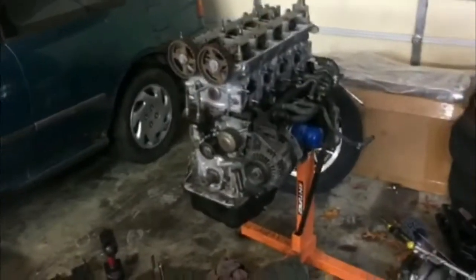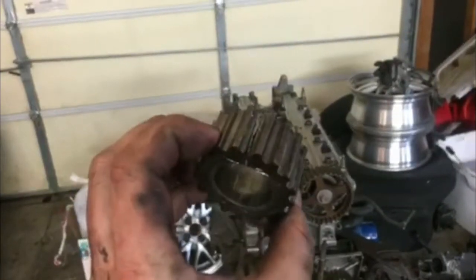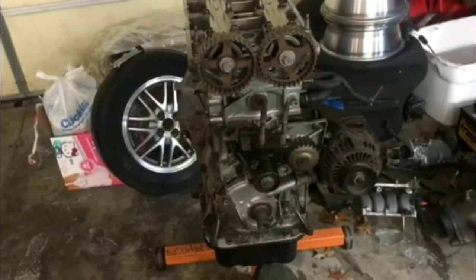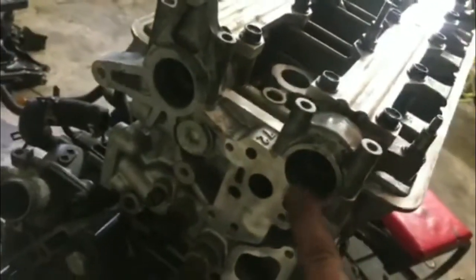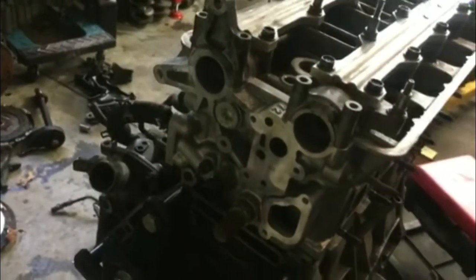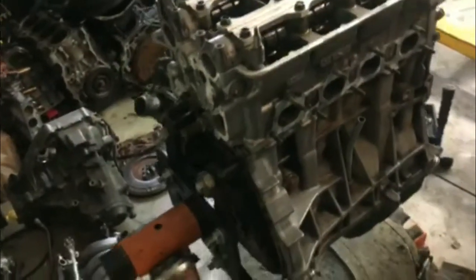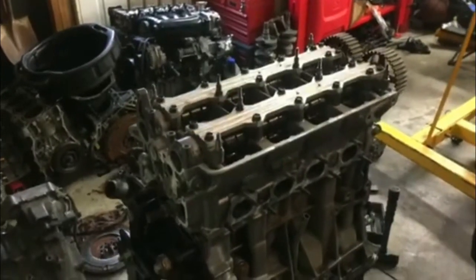As it turns out, I can't do the timing today — I've got a broken piece here so I'm gonna order a new one from Honda. I'll take this off the stand, get the clutch, flywheel, and trans on it, and be done for the day. I need to order that timing sprocket piece and the new updated cap that just clips in instead of using sealant. I also need to take the VTEC solenoid and clean it out because it's all gunked up from the junk that was in it. After that this thing will be ready — throw on the intake manifold and rock and roll.